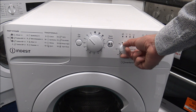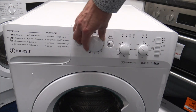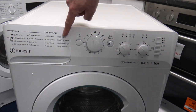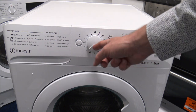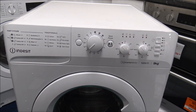As you come around here, you've got the different temperature options. If you have selected, say, a cotton program — if you were to select program 9 at the bottom here — that's one of the programs where you can vary it all the way up to 90 degrees if you wanted to. You have got the option to change the temperature for most of the washes, though some of them will be fixed. For some of the programs, if you were selecting the white option — which on here is program 11 — that will give you the ability to wash at any of these temperatures, so it's one of the few programs where you can go all the way up to 90 degrees. Some people still want to do a boil wash, as they've called it over the years — that's really good for things like towels, or if you want to put it through a service wash, then that's a good one to select.